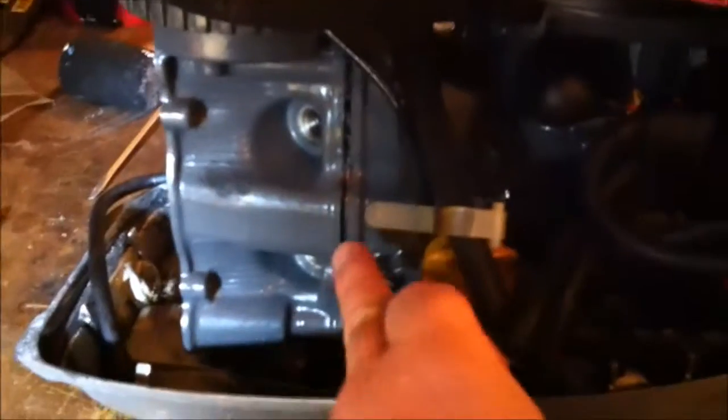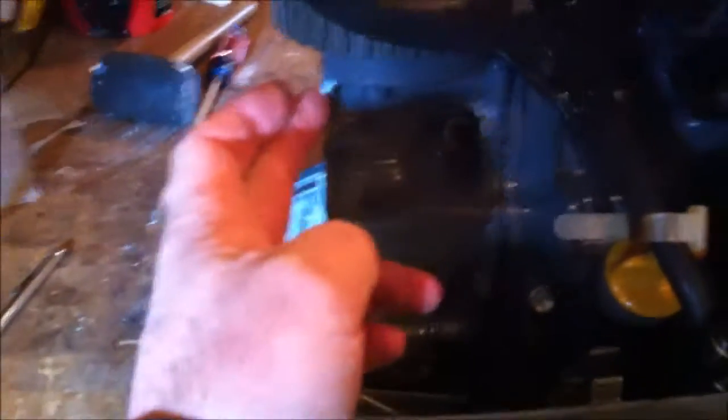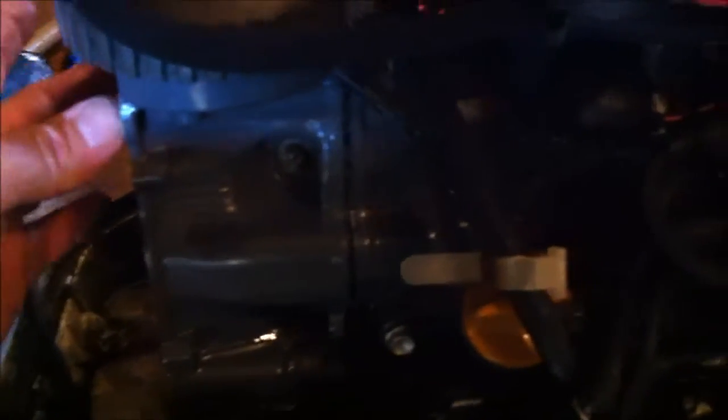When I was pulling these bolts out of this casing, the top bolts had salt buildup on them, whereas the bottom bolts were more coated in oil. That's definitely a reflection of a head gasket issue.